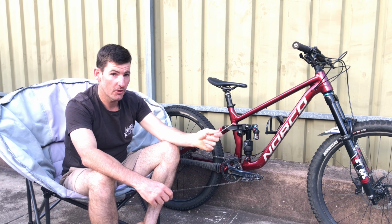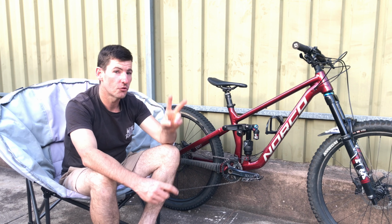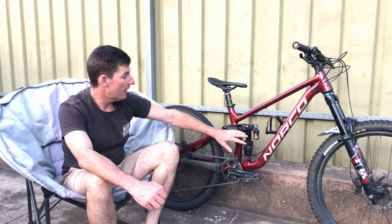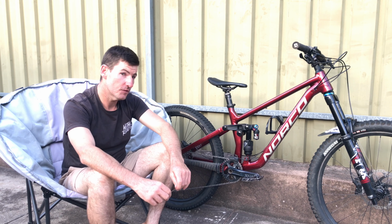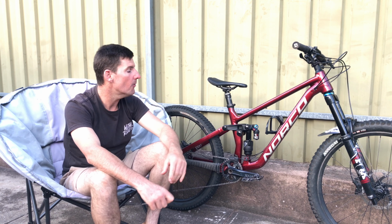But on the trails that I ride, the stiffer trails, if I was to go to Fox, I'd ramp that low speed up 2 clicks, maybe 3, probably 2 clicks, and send it as is. Same ride height, pressure, maybe another click of high speed compression, leave the rebound as is. Just because it's smoother out there, there's not as much choppy, loose, narrow trail.